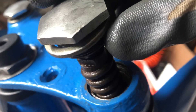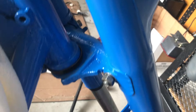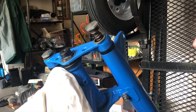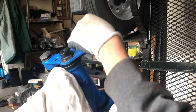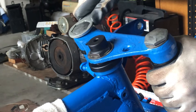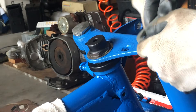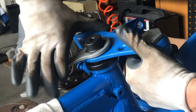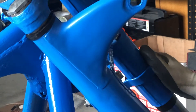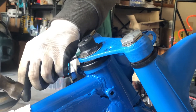It's hard to push the tightening nut all the way down to secure the fork, so we need to pull the fork all the way up and tighten the nut to secure it in the upper position. Then pull the lower part of the fork down — that's how we easily secure the nut. Make sure everything is tight. The lock washer should be bent a little bit before installation; just do several taps to lock the nut.